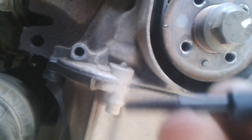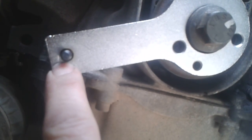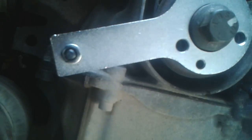Got this piece here that slides in that way first, into that hole, pinch tight there. Then got this part of the locking device that fits on the camshaft there, and that hole goes over that little stud piece, so that's in place there now.